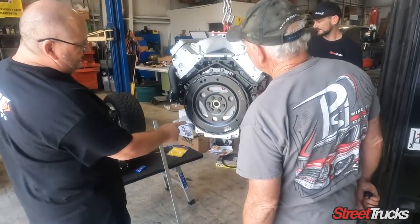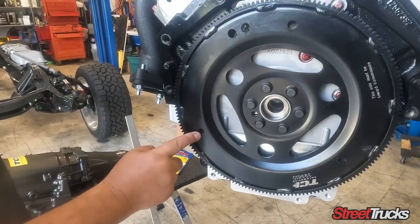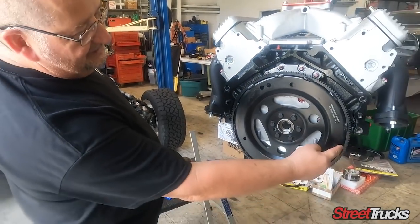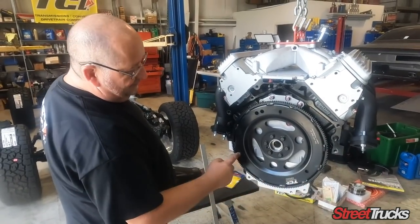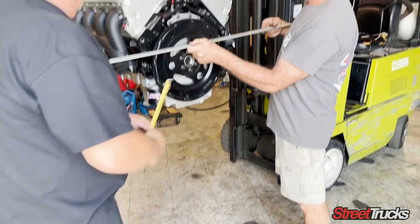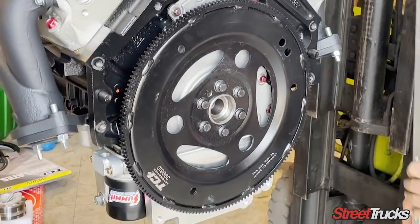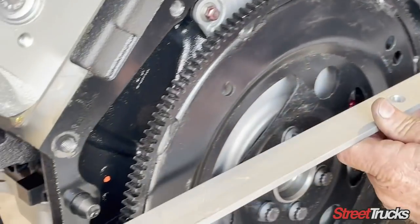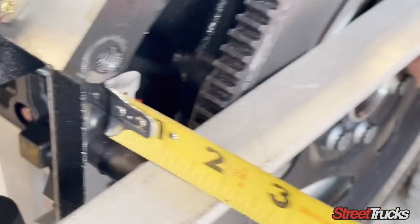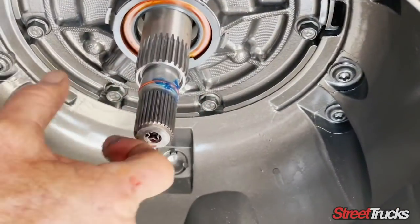Okay, all right. So, here's a trick I'll show you. If you look at this hole, here's the three torque converter holes. If you'll notice, that one's shaped different than these two. So ideally, if you line this up, usually, like you pointed out before, the starter hole. If you put this over here, you can actually put that bolt in tight, and these two will line up. Then measure right to your bell housing flange, and that's right at 7/8 of an inch in this case. The tape measure is close enough. Yeah, sure. Go ahead, put that up there. Can you see it there? Yep, 7/8 of an inch. Okay, makes sense. So keep it from hanging up when you're trying to put the converter in there. Be careful, that O-ring is important.